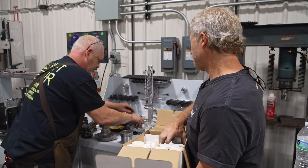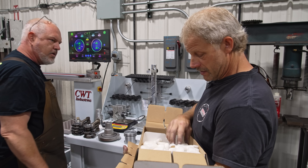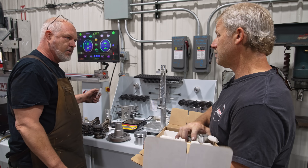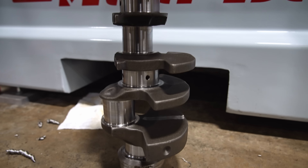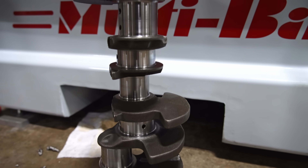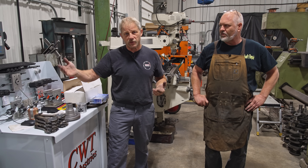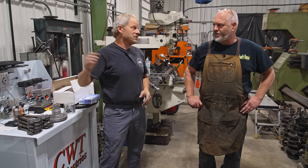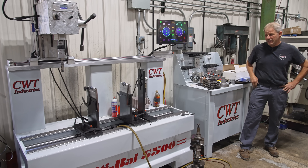From the factory, it's my understanding that Rover allowed the assembly to be out of balance — based on tolerancing — 60 grams. Doug has already done the crankshaft turning over in the other machine. Lots of times we'll use a different shop for balancing, but since we don't have anything else to do with the motor, Doug's going to show us his fancy new equipment and we'll go through all the balancing here — one stop shop today.